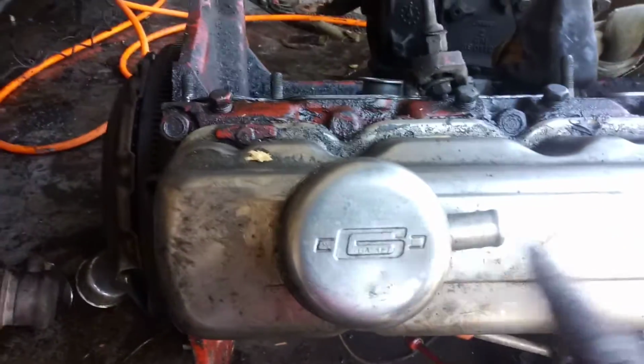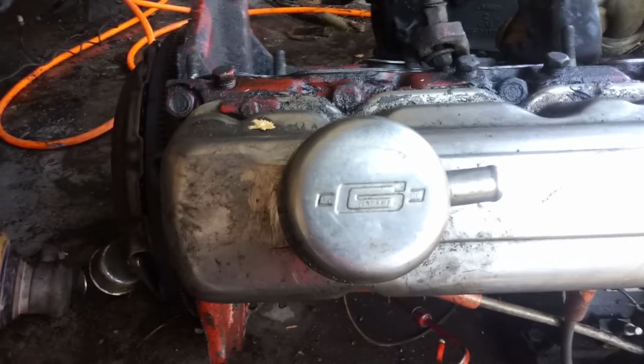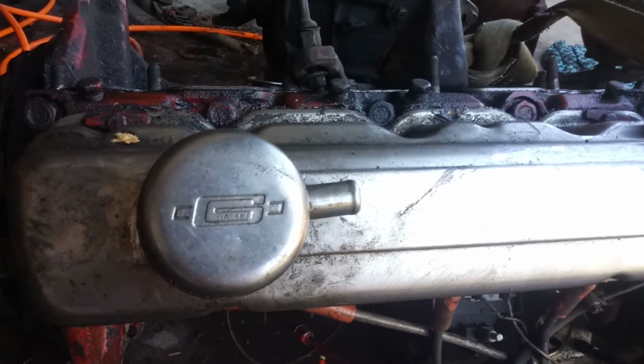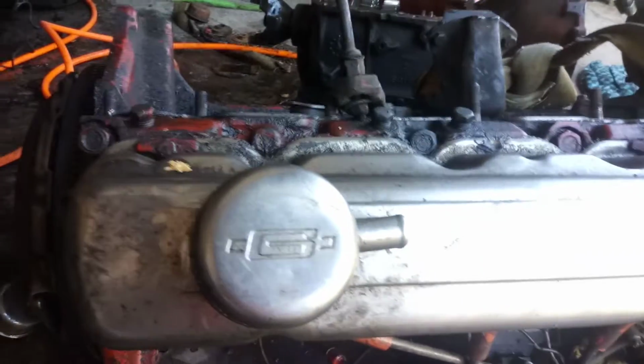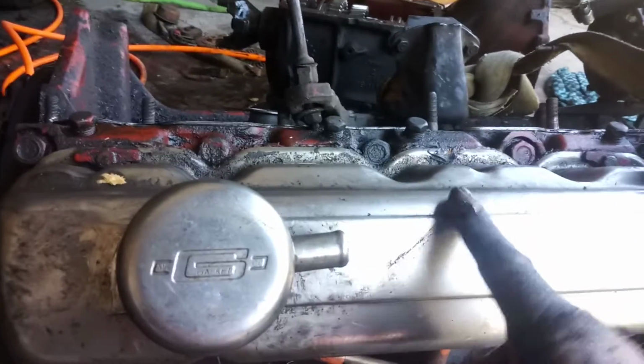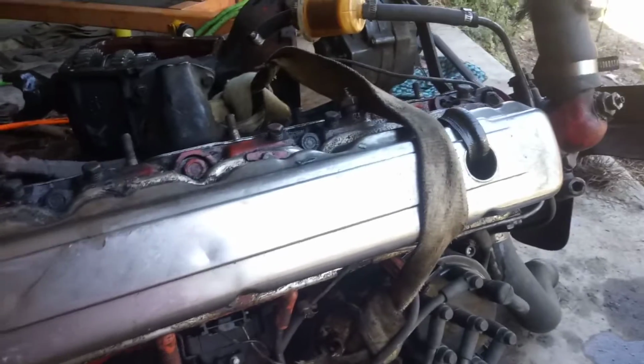And no, I'm not selling this motor. I'm not going to give it away neither. Well, no, not this one. The one that's at my other house that I got to move. I still got it. It's been covered up. I pumped a bunch of bearing grease in the spark plug holes and smeared a bunch of grease underneath the valve covers. Just packed it full of grease and then wrapped it up. Because the other motor had a blown head, a cracked head, big time, whenever I was going over to, what do you call it, Louisville, to a paint and body shop over there.